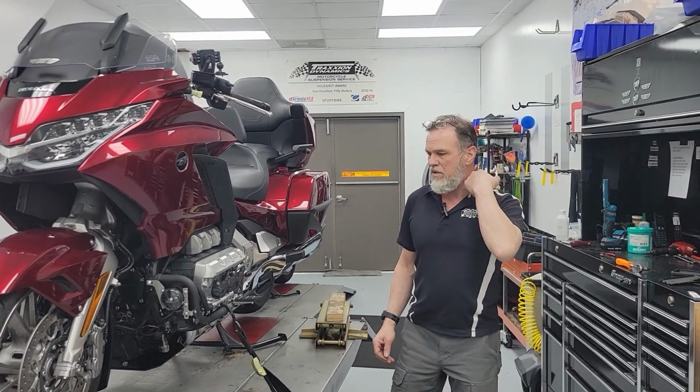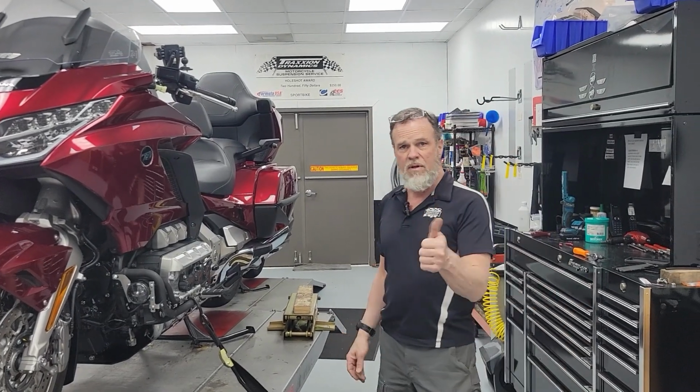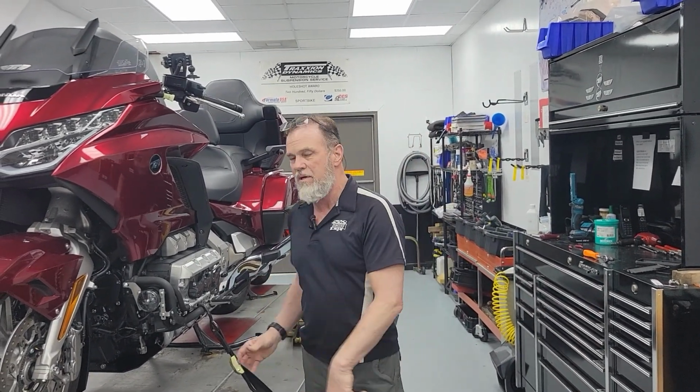We've also come across 3 late model 6-speeds where for some reason the engine cases are farther apart, the front to rear gap, by a pretty good amount, more than a millimeter, 2 millimeters or something, strange with no explanation. So anyway, one cure solves all. Going forward, you won't use any shims anymore, nothing. There won't be any issue with that. So anyway, that's the traction plate. Thumbs up. I'll be back with the other plates in just a moment. Thanks.